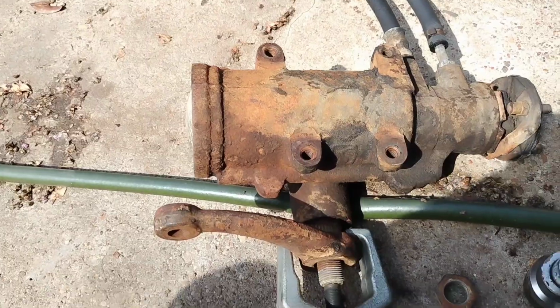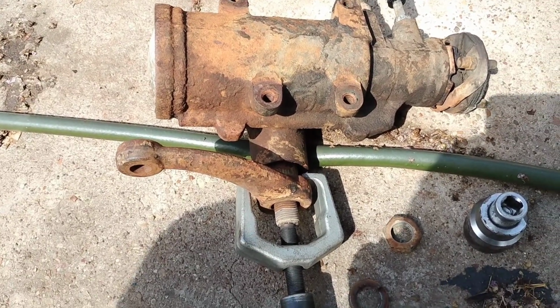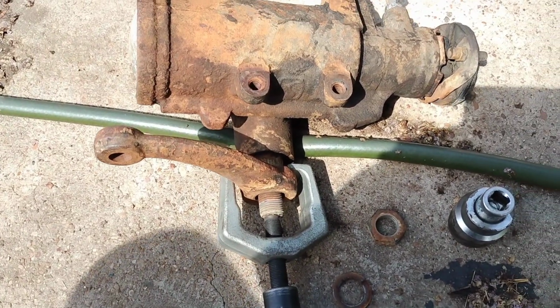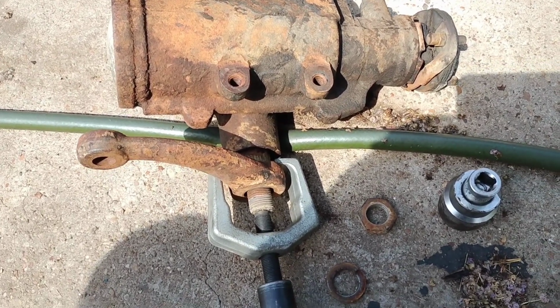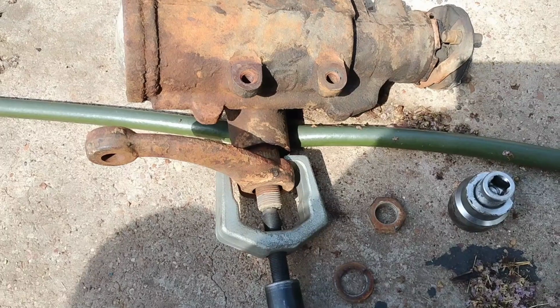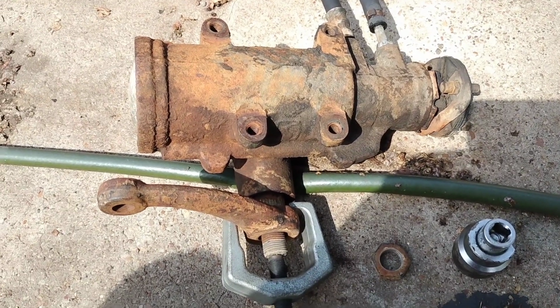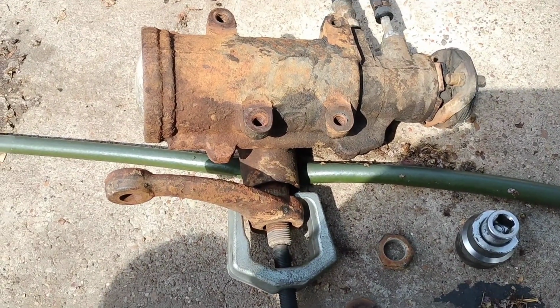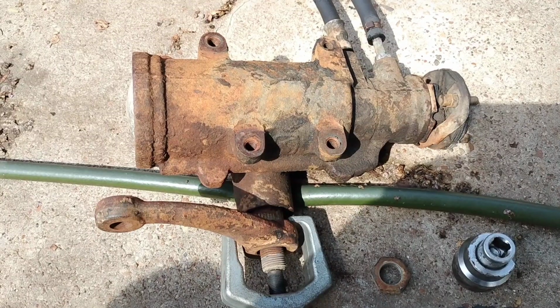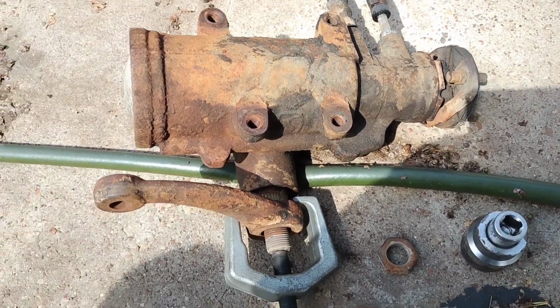I have to go get my puller to get that off. Pitman arm puller. GM guys, at least I can speak. There's so much steering gear box interchange. You just got to get the puller, man, because you can use an S10 manual steering box on a 63 Catalina, as long as you have the Catalina manual pitman arm. And your power steering pitman arm's different than a manual pitman arm, and the pitman arms are specific to the chassis. But there's a huge range of Saginaw gearboxes that work. Of course, the later power steering ones went to tube, O-ring, or whatever in metric. So if you go like 80s to a 60s, you're going to have the different power steering fittings. But it still swaps around all that.